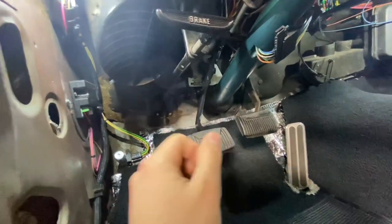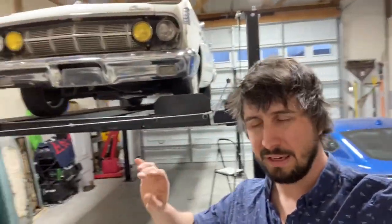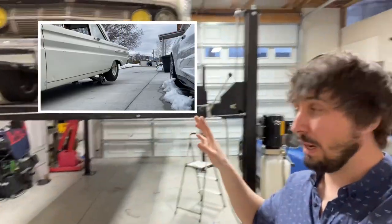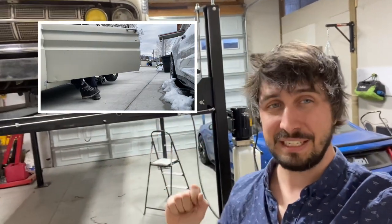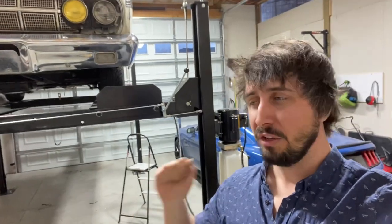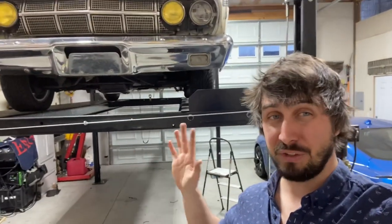For those parts of the instructions, look at Modern Driveline's pictures — they do a pretty good job. Once everything is bled, come inside and make sure you get a nice firm pedal. If it moves, you've still got air in your system. The pedal should be firm from top to bottom. The instructions recommend putting the car on jack stands, putting it in gear, and making sure you can get into every gear. The wheels turned at first because I didn't have complete disengagement of the clutch — I went back and rebled everything, did the test a second time, and then I was good. Take your time and make sure everything is good before you take it out on the road.